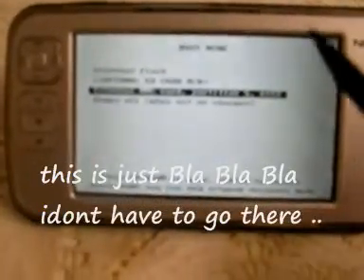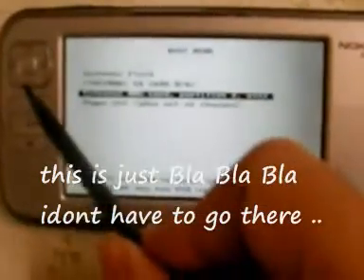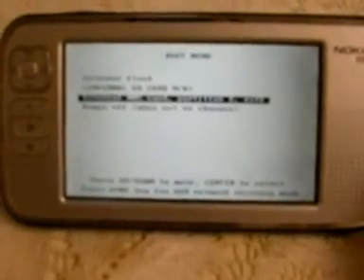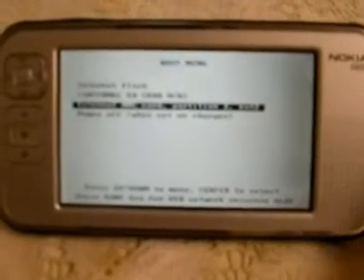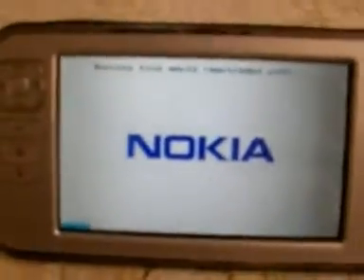Before that, there is an advanced option — if you click and hold the home key you will go back to the advanced options. I never went there and don't think I need to. I believe the home key gives you USB network recovery or similar options. So I'm going to boot from the SD. We go to the SD, click OK, and as you can see it says 'booting from MMC1/2,' which is the SD card.